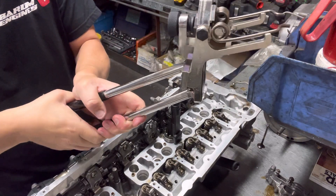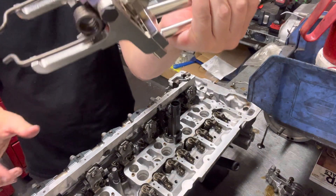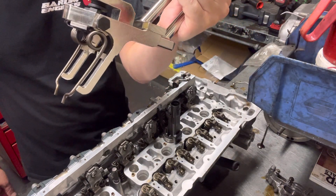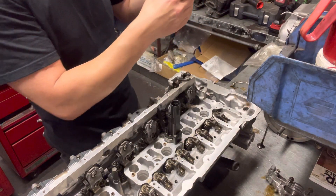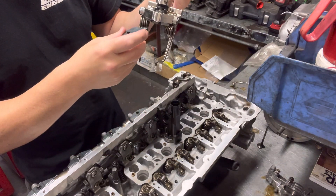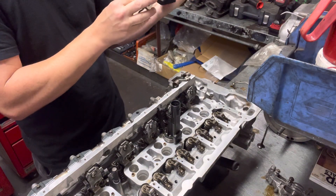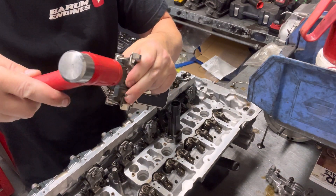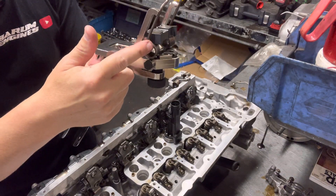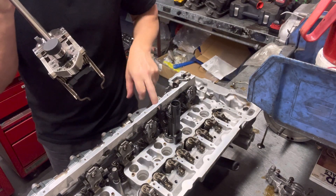Until this little stop here clicks into position. So that now means the spring is sitting as it should be — I mean, you imagine trying to bend that by hand, you wouldn't do it certainly not. That is installed. Then what we do is we take the spring seat and locate that into this as well, just tap that back as far as it can go. Now you can see where the spring is sitting on that, and that is how it goes onto the cylinder head.